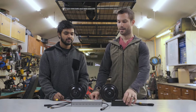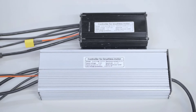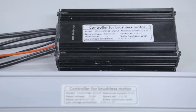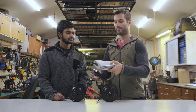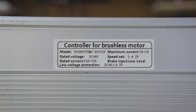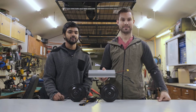Now let's look at the size of this controller. This is a custom controller manufactured for us by KT Controllers, which is one of the biggest controller companies in e-bikes. We specifically requested the maximum power availability out of it. Each motor is pulling a peak of 25 amps, and it's a 48-volt controller that can also run 52 volts — so that's some serious power.